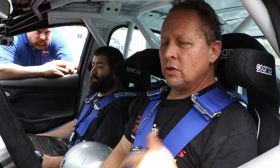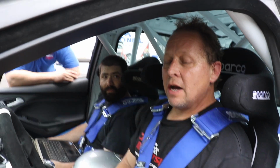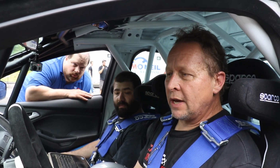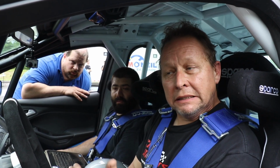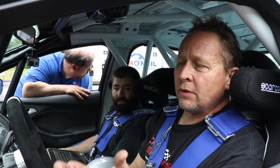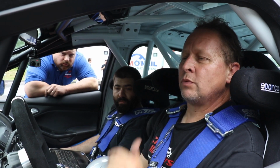One of the things I know, on the Mountune, we use the Cobb Accessport in the Mountune, and we run the 93 octane tune, and I'm just running straight pump gas. The amount of torque that we get running the tune on pump gas is amazing to see. But even though I've gotten all this power, I went ahead and put a restrictor in to make it legal. So now I've lost some of that top end. When I shift down, because of the restrictor, I have to keep the revs down. If I'm running around 3,000 to 4,000 RPM, it pulls the same even with the restrictor.